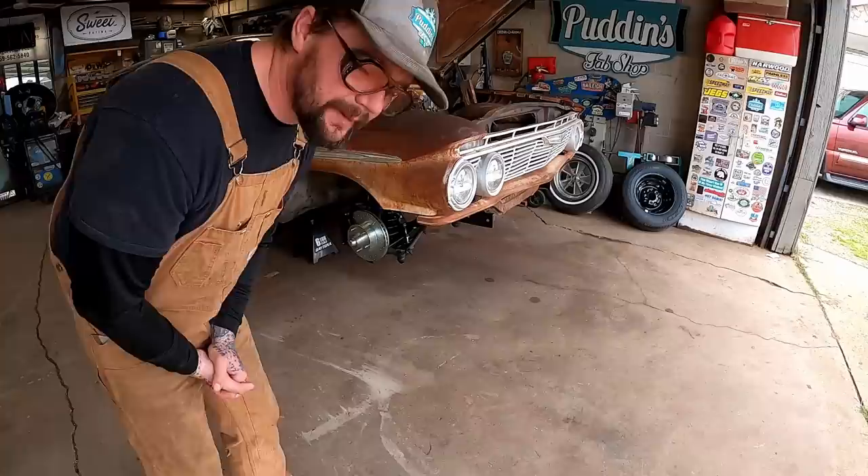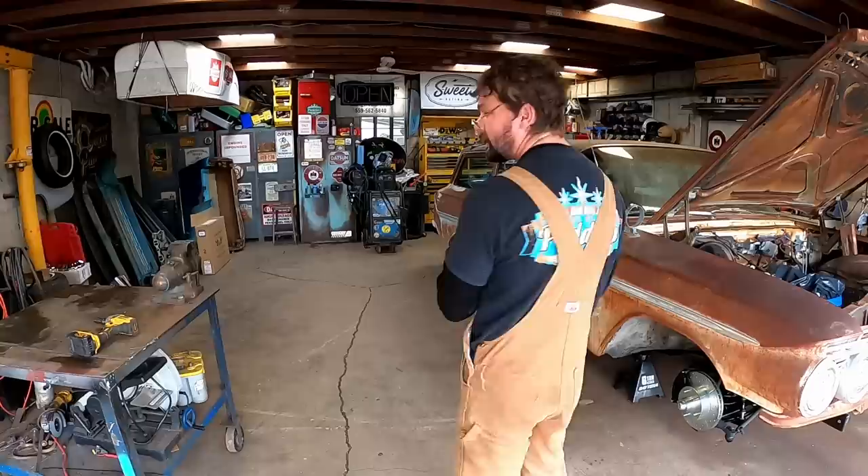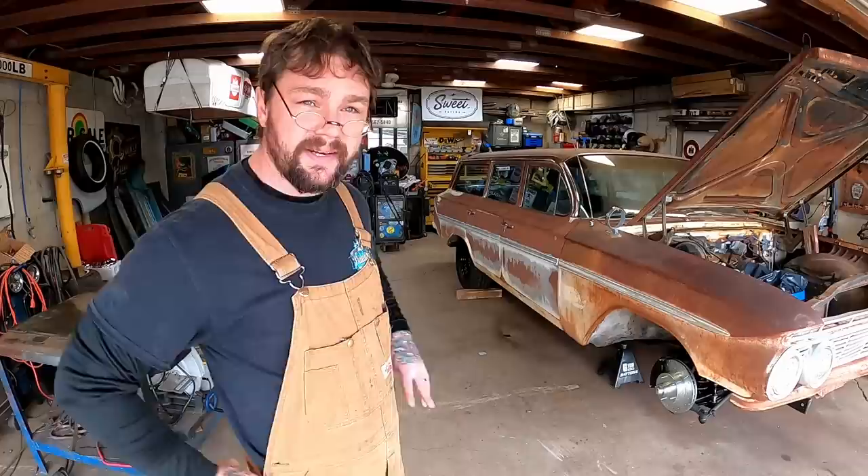Here's my theory. Welcome class to suspension theories - I'm your professor, Professor Pudin. Years and years of research have led us to this moment for me to present my Liftium Theory of why this wagon is sitting like Grave Digger: simply because of bad manufacturing. You see, a coil spring has a pigtail where it ends, and usually manufacturers have an area where the pigtail is supposed to sit for maximum seating. However, due to poor manufacturing, springs do not always index correctly, thus not sitting in flush and properly.